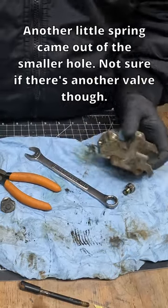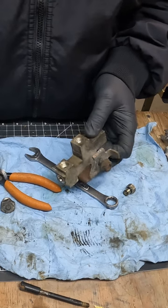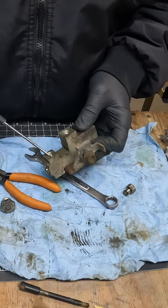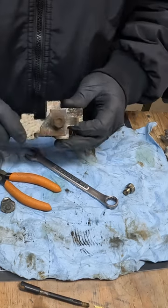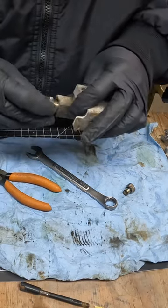The reason why you gut these things is because this provides a bit of brake bias to the front, rather than the rear brakes. When you do a rear disc conversion, you don't want to really need that bias in this. You do need a brake proportioning valve. For now, we're just removing the proportioning portion of this.